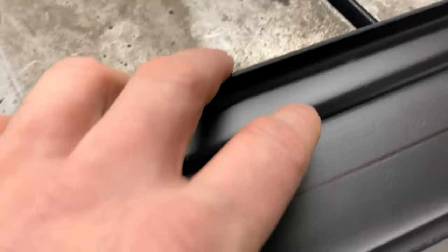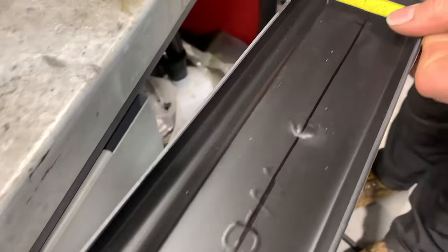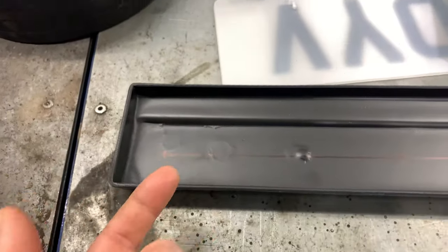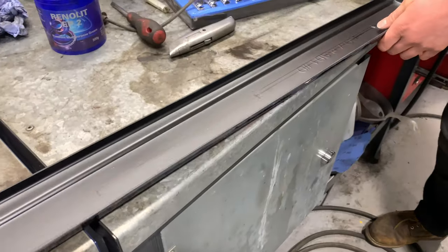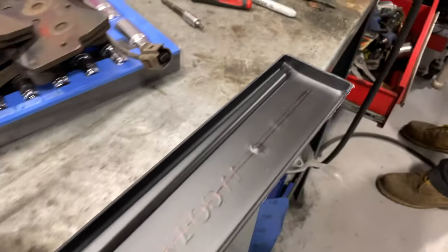So what we're doing is we're taking it about 25mm from there, which is where the side skirt is, roughly. It's a little bit out, about 5mm, but it'll be alright. So that then means we should have enough there for the screw to go on, and then we'll put the tape on first, obviously, and stick the side skirt on. But we're going to pre-drill all the holes, so it's not too bad. Theoretically, you wouldn't really have to because they're self-tappers, but you could just do it as you go. At least we've got a point now where we can come to.